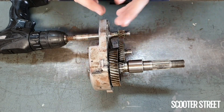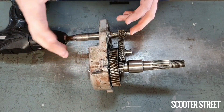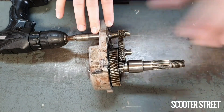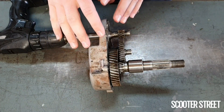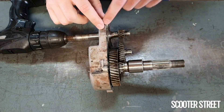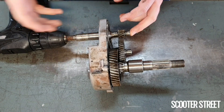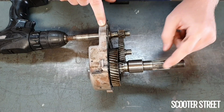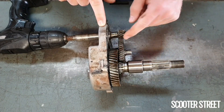Then past that, in behind your torque driver, in the back of the transmission, you have this little plate here. On some scooters it's on the outside of the transmission, bolted on. On this scooter — it's from a TGB — this is a similar setup to a Piaggio as well, where you have a plate on the inside of the transmission casing. In behind there is this diff gear. This shaft here is the shaft that your torque driver goes onto, and this here is your drive shaft that the wheel is bolted onto with the spline matched by the wheel. You can see there's a little series of gears inside here.